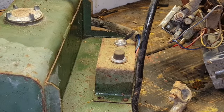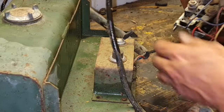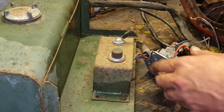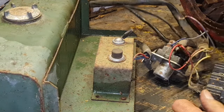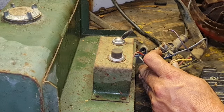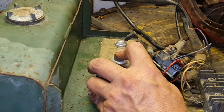There we go. This may look daunting. It's very simple. This is a voltage regulator. That's your solenoid for your starter motor. Positive cable for the battery. So this cable here will go on this to the battery. This other cable, what I just had. No, it isn't. That's this one. This one goes on to your starter motor and you just connect them up to a battery, push this button